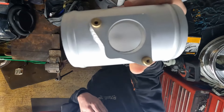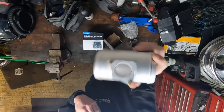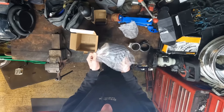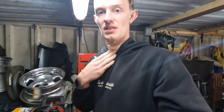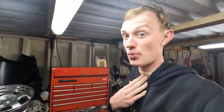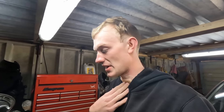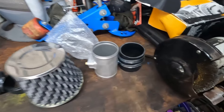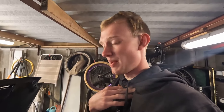This is the new MAF housing. The MAF sits in there on the throttle body side. So it goes throttle body, then this. There are the three major components we're going to need. We've got to take the MAF out of the old housing and make sure the wires reach - I think that's going to be the biggest challenge. It's a bit of a relocation job. It goes: tube, MAF housing, then I'm going to put the air filter straight on the end of the MAF.